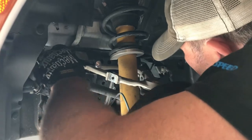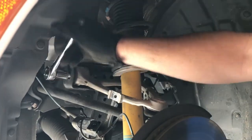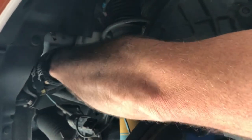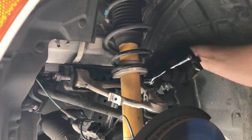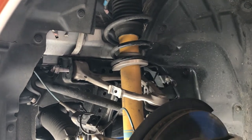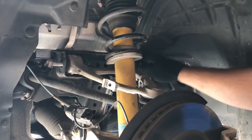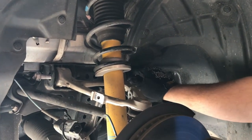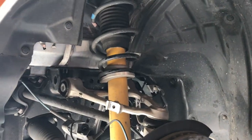And the beautiful thing here, actually it looks like I didn't even need the wrench. It appears that those nuts are welded to the subframe, which is a vast improvement over the previous Miata, which had a single large bolt running through here. The RX-7 third gen has a very similar suspension design to this, and you have to hold the nuts. So kudos to Mazda for improving the design. And as you can see, everything just wants to fall out now.